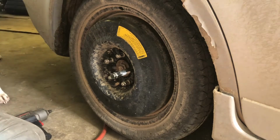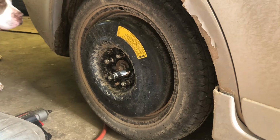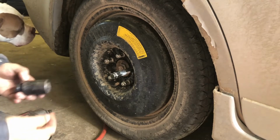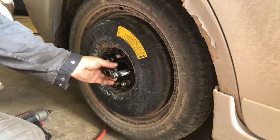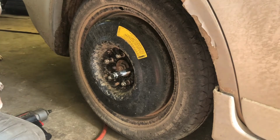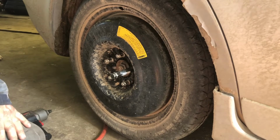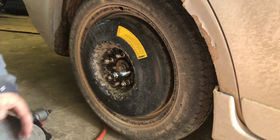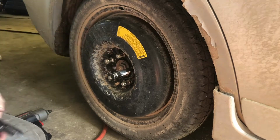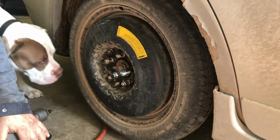Okay, so anyway, we're taking the wheel off. We need a 1.25" socket to take off the axle nut. Need snap ring pliers. I made a tool for my slide hammer to pull the hub off. Hope it works.